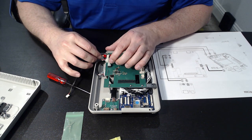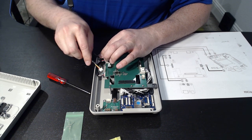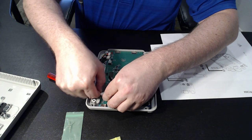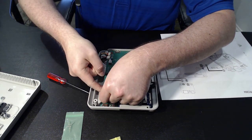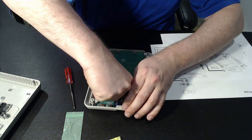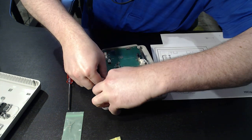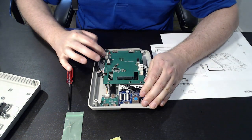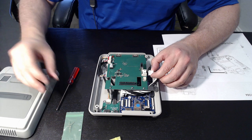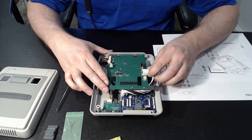Now the cable which is underneath and is the top USB 2 port actually swings around to the back port on the front side, and we install it with the little teeth facing upward. Go ahead and get the last cable installed — this one can be a little bit challenging, so just be really careful and gently guide it into place and get it seated. Make sure the little guides are on the top and you want to feel a physical click when they plug in. Be sure to plug in this cable with the white facing up and feel the clip.